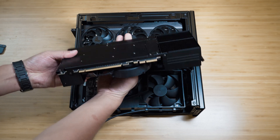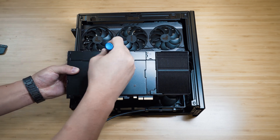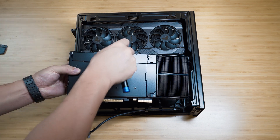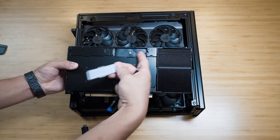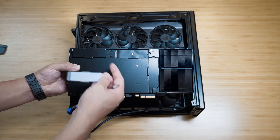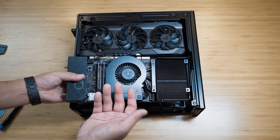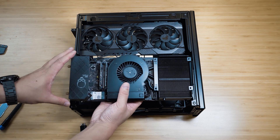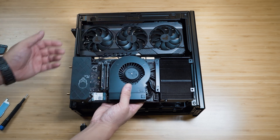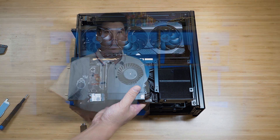On the other side of the compute unit, there are three M.2 SSD slots in PCIe 3 format, taking the 2280 size. You do need to remove the compute unit to access storage, but you can access the memory without removing it. I must say, disassembling the NUC 13 Extreme is much easier than the NUC 12 Extreme — it's not as crazily compact. That extra wiggle room means less risk of getting scratched up by the computer. I really like the size.